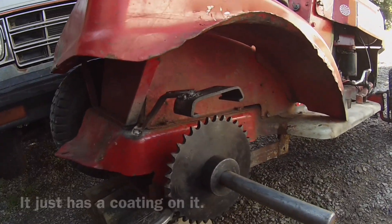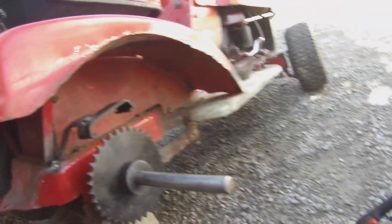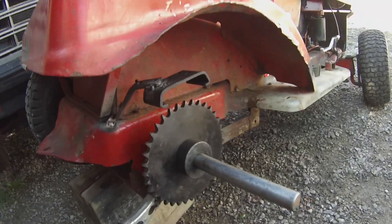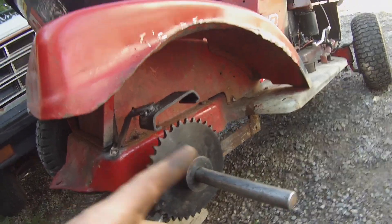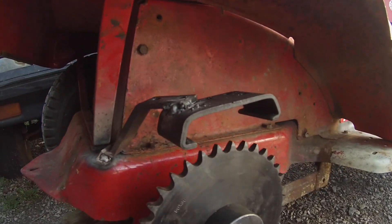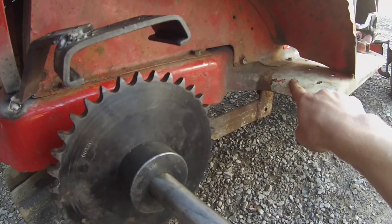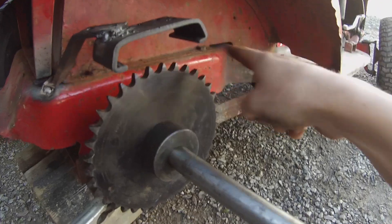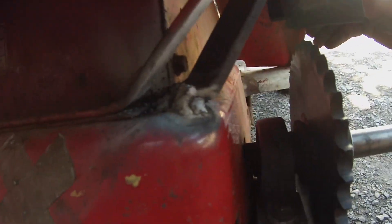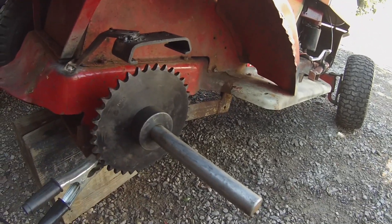I've figured out this bracket. I don't know if it's cast iron but it's welding like crap. I was able to get that welded on there. I was worried about whether I could slide it off since it's a two-piece type thing and it can't come off because of the lever there. So I'm going to figure out another piece — maybe I could go from there to there, just a straight shot. I've got some decent weld over there, but I kind of got tight on room with the bar there, so I'll weld underneath and then fully weld that.